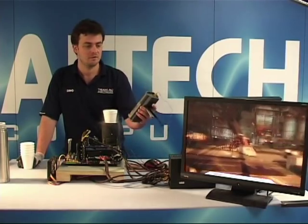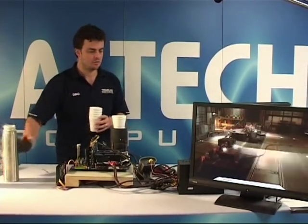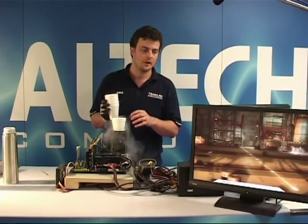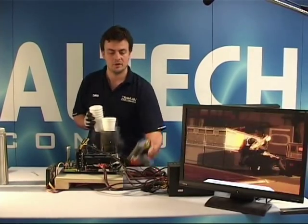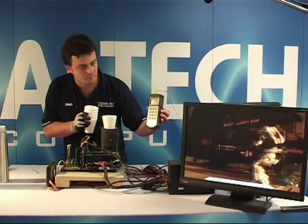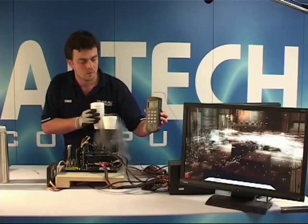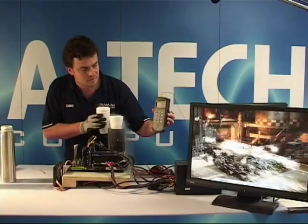So right now it's minus 75. Now, at this point, it's good to pour smaller amounts. You're not using large pours, you're only doing small touches. So only very small ones like that. And you basically follow the temperature. So I want to keep the temperature at minus 75. It's starting to drop, minus 74.6. Small pour. What that does, see, makes it colder again. Minus 77.